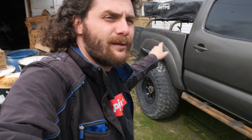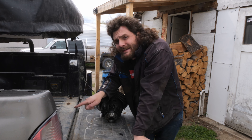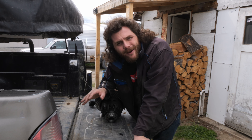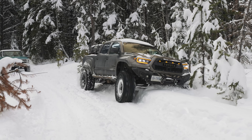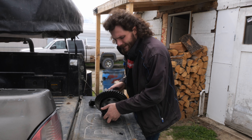When I first got the pair of axles underneath this truck, I noticed the rear end had a limited slip in it. To save money during the build I decided to run with it — some form of a locker. What I've noticed is the limited slip works great if both tires have at least a little bit of traction. Around the street going around corners I can hear the tires every once in a while, but off-road — specifically in the snow — when one tire loses traction, that's the tire getting power. It is not locking them up like I'd like.